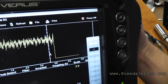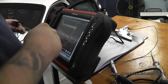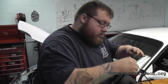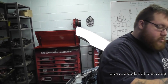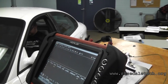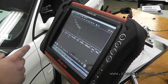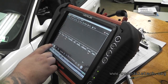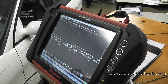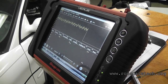Pull that bottom notice piece out — I get glare from my lights. Go ahead and crank it. We'll normally start the first time and then the next time it does it. That looks like crap — that's the best we've got actually. Let's try a filter and crank it again. Yeah, that's a horrible waveform. I'm not sure how I'm going to clean that up other than relocating the probe. Let's try the other cable — I want to go on ground, and go around both. The arrow is going to be facing toward the battery now, but we need the jaws of this clamp to close all the way.